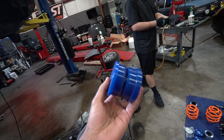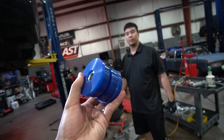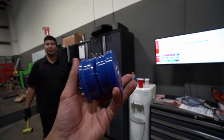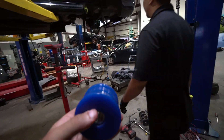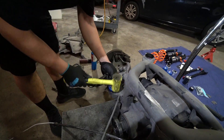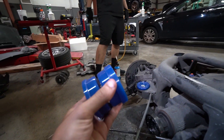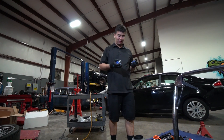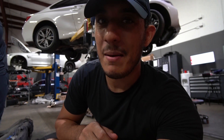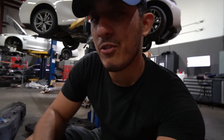Christian asks what to expect switching from rubber to poly bushings as a daily driver. Ali says not much of a difference in feel. The main reason people install poly bushings is longevity — they last longer — plus they are slightly stiffer. Compared to OEM rubber there isn't a drastic difference, so they're perfectly suitable for daily driving. Christian will report back once he gets to drive the car, but just feeling them they seem a bit stiffer, which is actually kind of good for an M3.